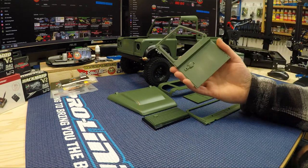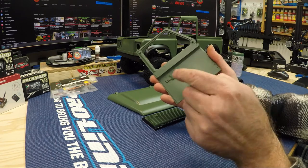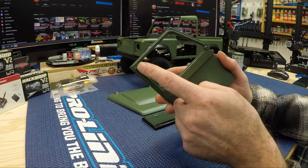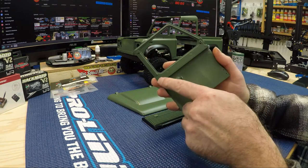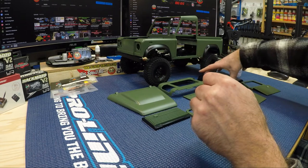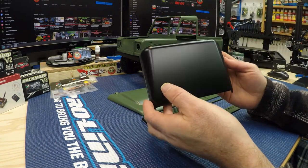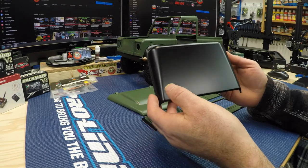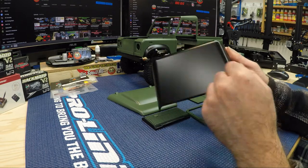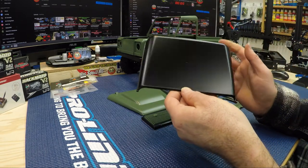For the doors, I didn't do the bottom parts of the door very heavily because they're going to be covered with the door panels from the interior. I did make sure to get this area covered, and I matte finished that also so it matches the outside. The roof is done in black, and the black I used is Rust-Oleum 2X Ultra Cover paint, and again it sprays really nice. It's a little bit cheaper for a larger can, so all the black that I've used is that Rust-Oleum.